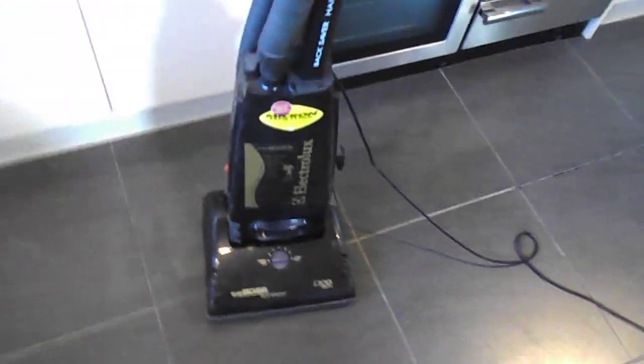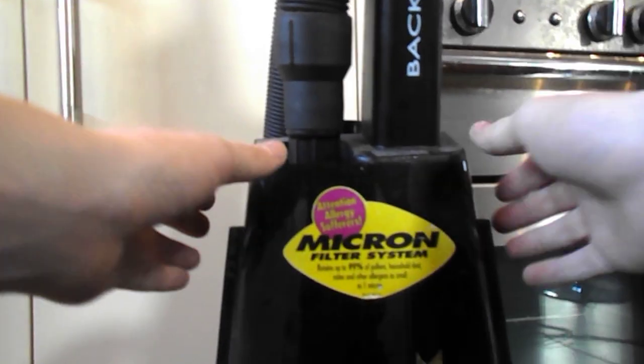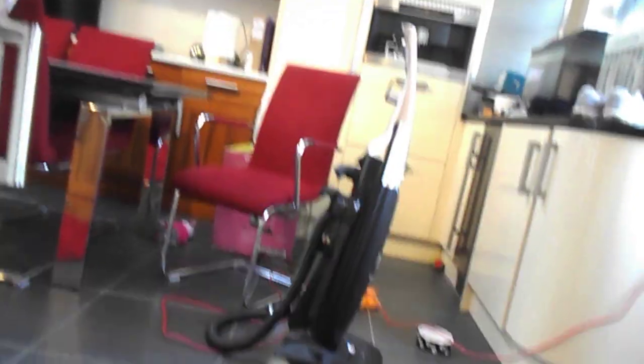It's the Boss Stairmaster. I'll show you the bag compartment — you have to pull at both sides and the bag door comes off. I took the bag out because it had burst, so I've given it a little vacuum out. There's a filter in there which is wrong — someone's just slapped it in, it's far too big for the filter hole. I'm going to cut that to size — it should go over that metal grill, but it needs cutting down.